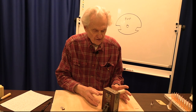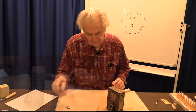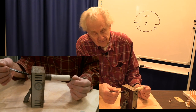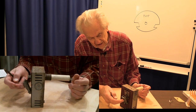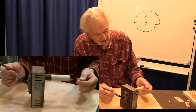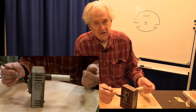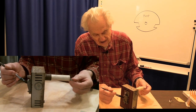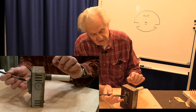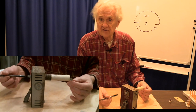I have an example of a small old kiln sitter here for demonstration purposes. The kiln sitter consists of the control box on the outside with the end of the movable arm, the sensing arm, and then there's a hinged weight here with a blade. The way the kiln sitter works is when the end of the sensing arm on the inside of the kiln drops because the cone has softened and bent, then the outside end of the arm raises up and the claw — that's this hook on the outside end — releases the weight, and it swings down and shuts off the kiln.